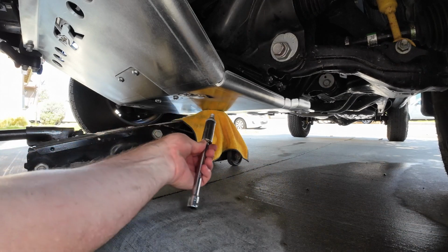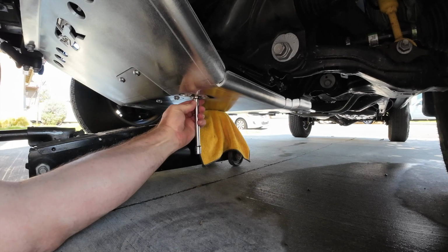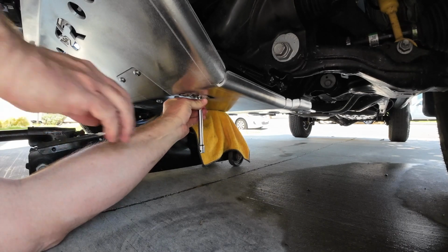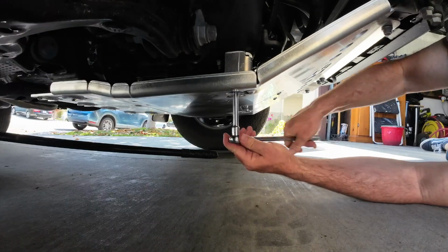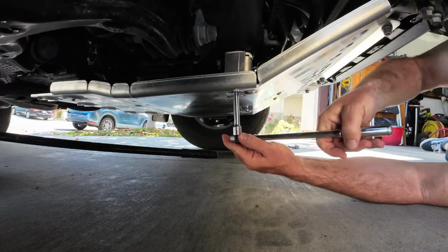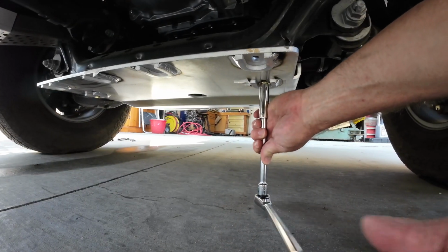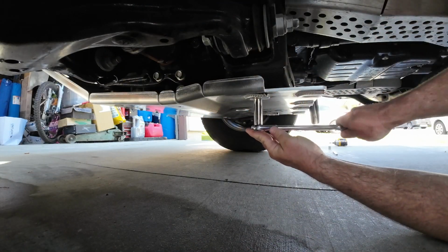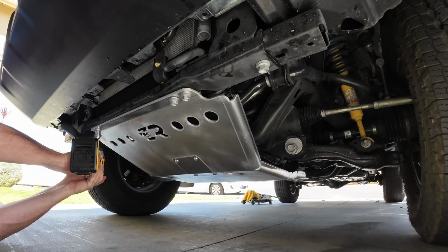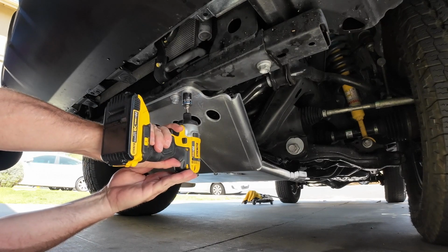The middle screws are deep set ones. It takes 2 of those 17mm bolts from the cross brackets for this step. I started with a 17mm socket and an extension to loosely thread these in first, then a 17mm ratchet to drive these middle bolts in and fully tighten down. Now back to those rear bolts with the 1/2" ratchet to tighten them down. I forgot the extension was a little bit too deep here. Then I zipped up the 3 front 17mm bolts of the skid plate with my impact, and that's it.